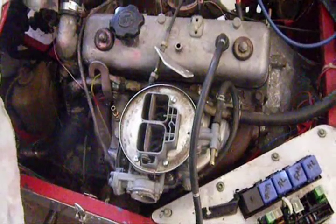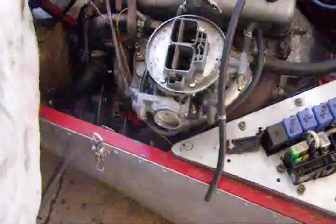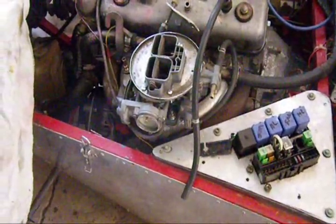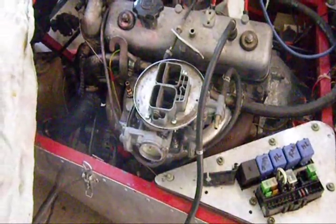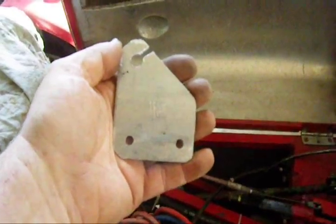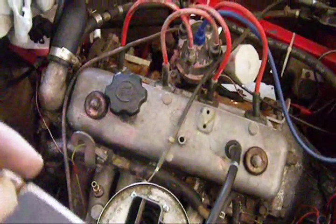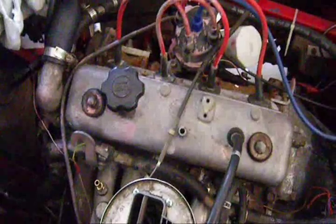It took me another day to get everything hooked back up again. It's all done now and I've actually cut the outside of the choke housing off. It seems that the default position is that the choke flaps stay open once you've tickled the throttle once, so I'll just leave it like that for now. I've just made a little aluminium bracket that will let me hook up the throttle cable. It will go onto the side of the rocker box here. I'm going to have to take the rocker box off and drill and tap it. I was going to do a fancy setup with a little pulley and all that, but I think I can get away with a straight run — that's probably better and simpler. Then I'll be ready to test fire it, or at least see if I can get it to run. Should be okay.